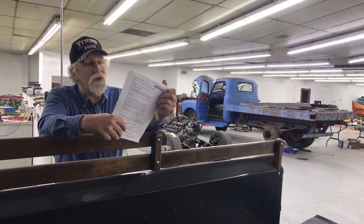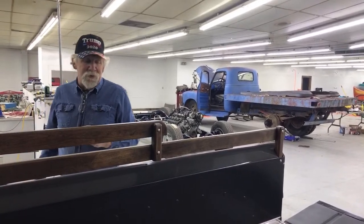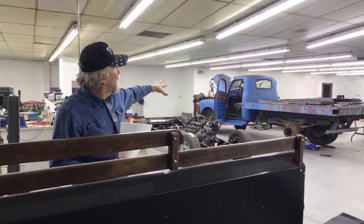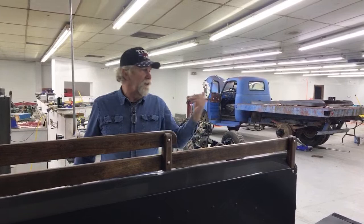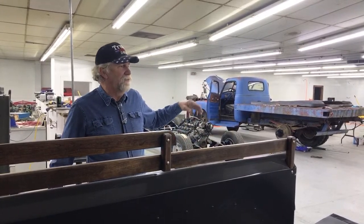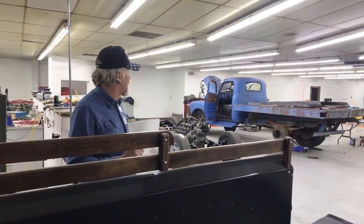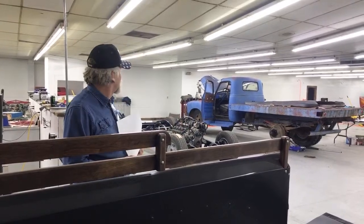Following directions is a good thing sometimes. Learning from experience is a good thing sometimes. Learning from someone who's experienced and can teach you is a way better thing — it's a concept we've kind of forgotten about. We're converting that to a 12-volt system in pretty simple format: change the coil, had a generator — you can change the ballast resistor and change the generator a little bit, but we just put an alternator on it. Make sure the ground is a negative ground instead of a positive ground — some of the years had a positive ground, so just be careful of that.